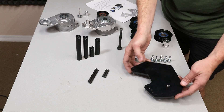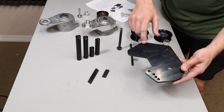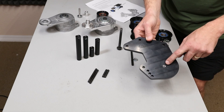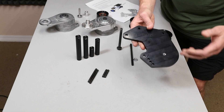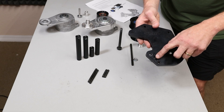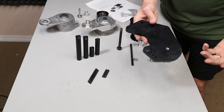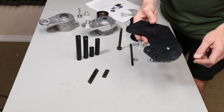First, I want to show you the AC bypass bracket itself. This bracket has four standoffs, and this allows for a total of five mounting points because the center bolt that holds the tensioner and the idler is actually a mounting point too. We've also got some other features here. There are multiple holes in the plate which allows you to angle the tensioner and take up more or less slack in the belt, giving you more options for pulleys or if you can't find the exact belt, you've got an option to change the length.